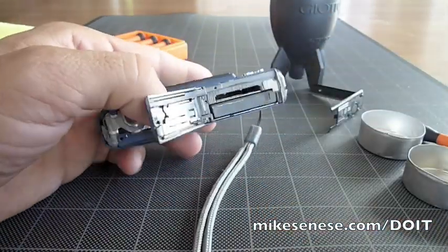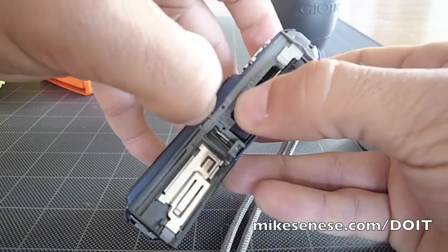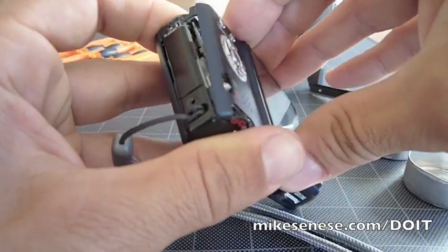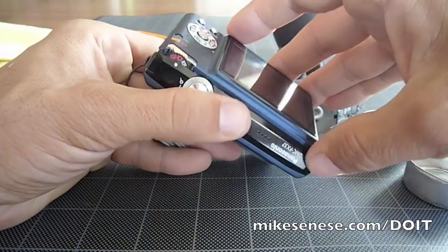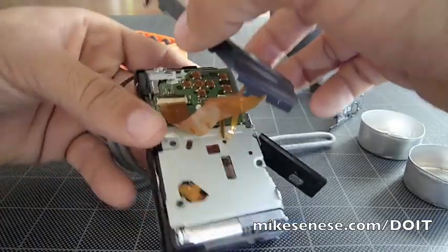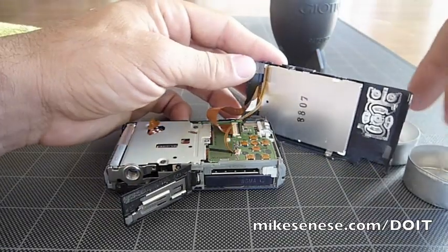Now to take the back of the case off, there's a tiny little clip where the back case holds onto the body. You want to press just slightly on the edge of the screen there — not too hard, so you don't want to break anything — to release that clip from the back body, and you'll see it lifts open. It clips on the side and at the top, so as you bring it open, be careful not to tear the ribbons that hold the screen in place. Carefully lift so this piece releases, and at the top there are two other clips right underneath the shutter button. By pulling and gently twisting you can get that to release. Now you can see the ribbon cables — be very careful about those. Go ahead and take the screen and put it off to the side, and maybe put something behind it to hold it in place.